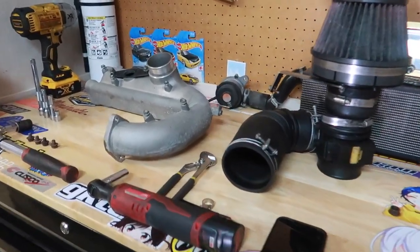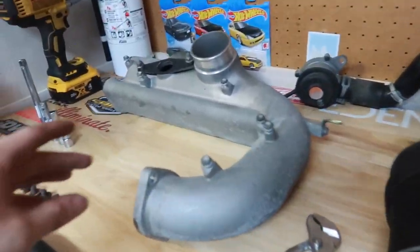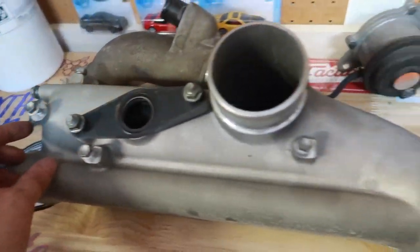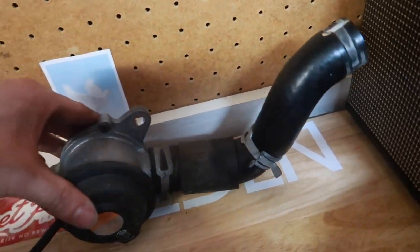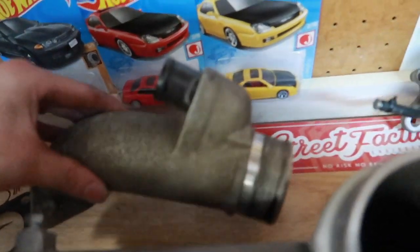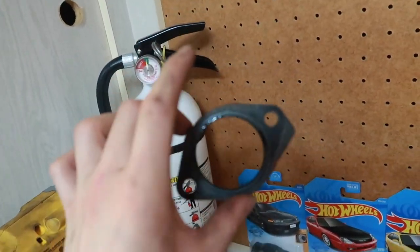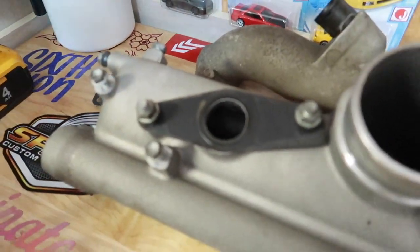We are making excellent progress. Just taking all the turbo parts and accessories out — got the air filter out, the J-pipe off. Helpful tip: put bolts back into their respective position locations so you don't lose them. It's just a surplus of 14s and 10s. Very easy to take off, just take your time. Stock recirculation valve is off. Hoses are good. I ordered a new Toyota OEM 1JZ GTE VVTI turbo gasket kit which should be arriving next week, because these gaskets are brittle and again they're 25 years old.